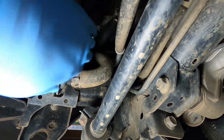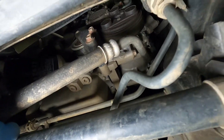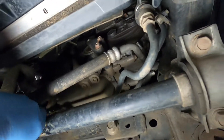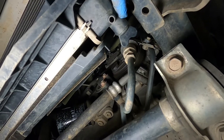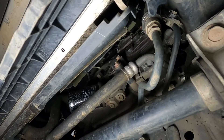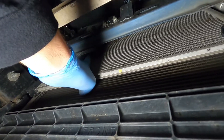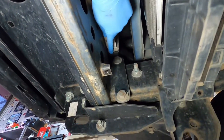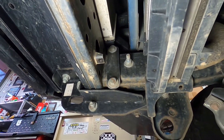There are your air conditioning lines. You can have a good look at your pulleys from underneath. When we do our coolant later, this is our drain cock here which drains the coolant out through the bottom. Also check your condenser at the front - make sure it's not completely blocked or full of leaves. This is your intercooler at the front - make sure there's no oil leaks out of the side to indicate the seal's gone in the intercooler housing.